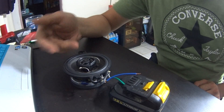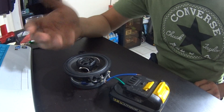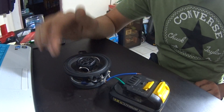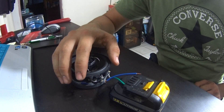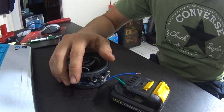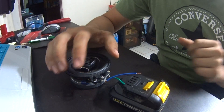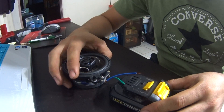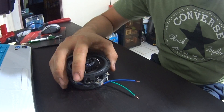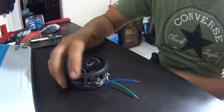You'll be able to see really quick which way the cone is popping and you'll know which lead is what. You want to do that to each door because generally each door has a pair of different color wires on the vehicle. That's all you've got to do. I'll show you what it's like checking it with a power probe in another video, but that's pretty much it guys — it's very simple. If you like the video please hit like or subscribe, and I'll try to make some other useful tips on car audio, video, and security. Thanks guys, peace.